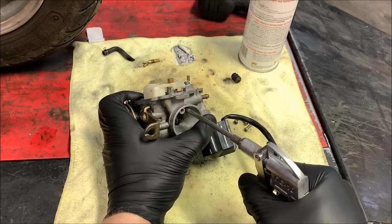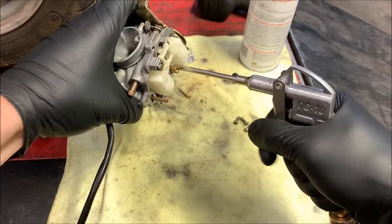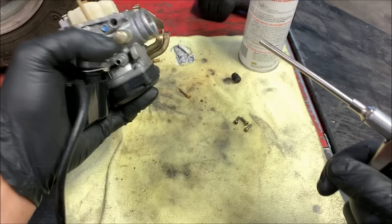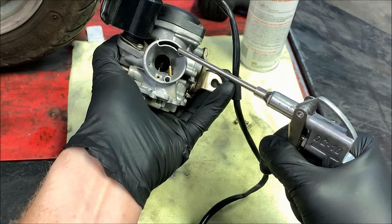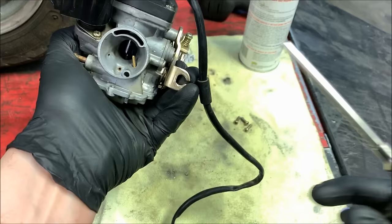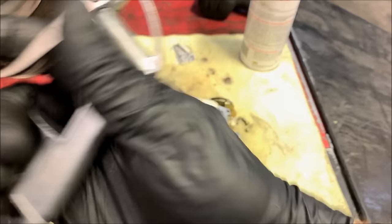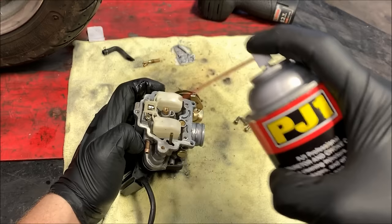With your air nozzle, go in the mixture jet circuit and blast it out. Then go in all the air inlet passages — the main jet circuit, the pilot jet circuit — and any pathway you can blow air, just go for it. The only one you want to be a little careful with air is the diaphragm up here; you can blow lightly just to see it go up, but don't go full throttle with that one. You can also go through the air inlet for the auto bi-starter choke circuit — those don't really get plugged up that often, but just as an extra precaution you can blow air and carb cleaner in there.